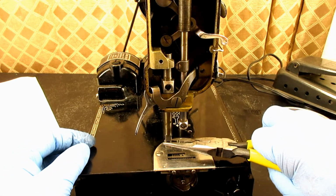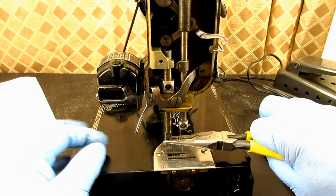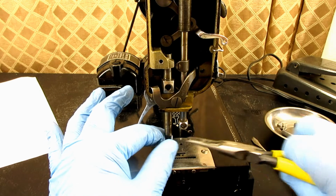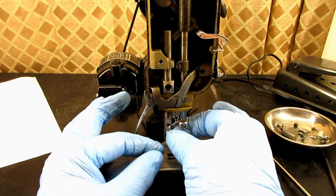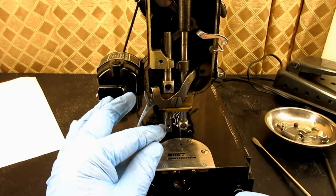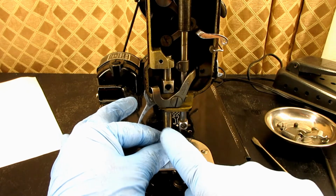I get many emails every year about this, that it won't budge. Are you sure it comes out? But it will. You just have to be patient sometimes, or use heat or some liquid to soften it. And even when you start moving it down later on, if it was stored with the needle bar up like this, down in the bushing you can have a big glob of oil that's settled there and dried, and you get a little ridge line of that hard oil at the bottom of the bearing right on the presser bar.